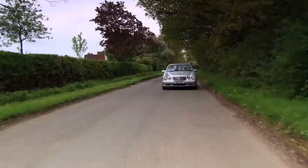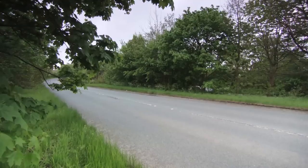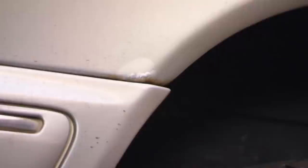When you take one of these out for a test drive, try and find a few potholes and listen for any clonking coming from the suspension, because these cars were notorious for wearing out their drop links. Budget about £150 to have them done. Try and get the car up onto a ramp. These W210 models, AMG or not, love to rust — pretty much everywhere.